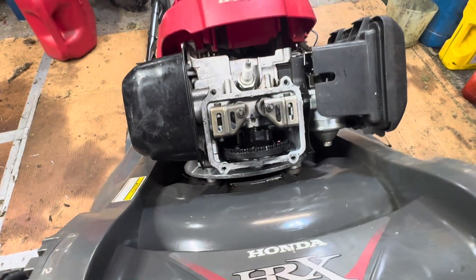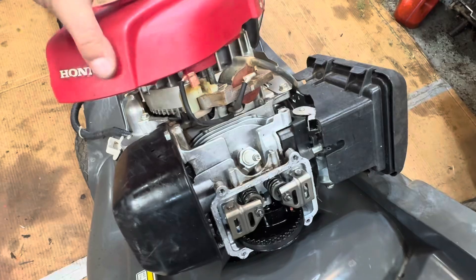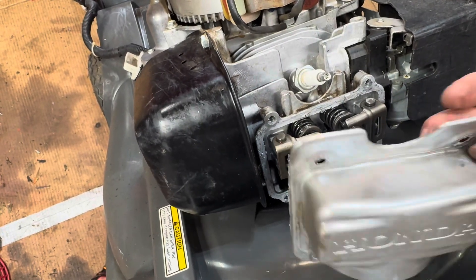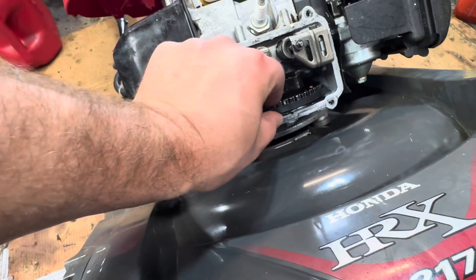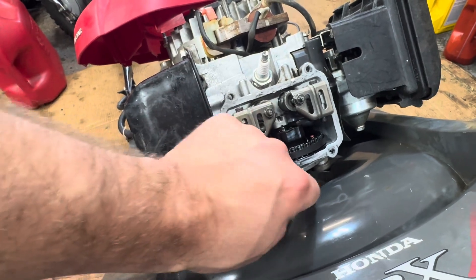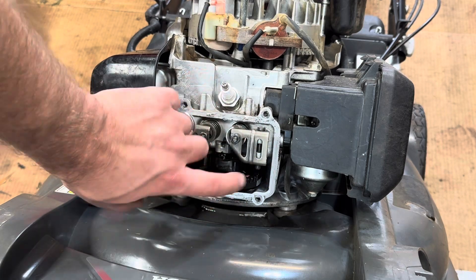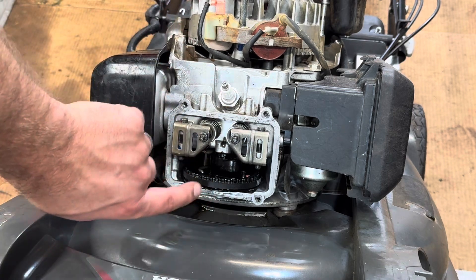The easiest thing to do is get the pull starter off and get the cover off so you can get in here. To get this valve cover off, sometimes it's hard — sometimes you can just grab hold and pull, but it'll bend. I usually try to get a flat screwdriver in behind here and pry it forward a little bit to pop it off. We don't want to go all the way out with the shaft — just far enough — we don't want to mess up any timing with the timing belt. Notice I have the mower propped up on the handle with the front end up, so I'm not going to lose a lot of oil out of the valve cover. Tilt it back, leave it five to ten minutes, and enough oil will drain that you won't get much loss.